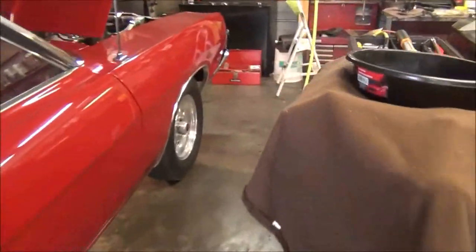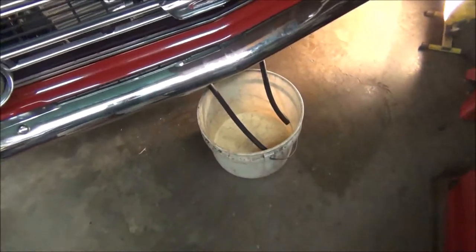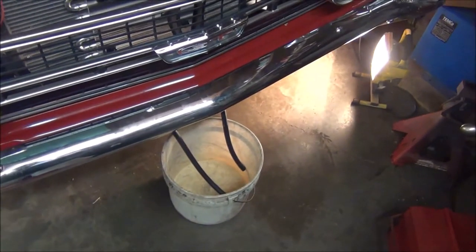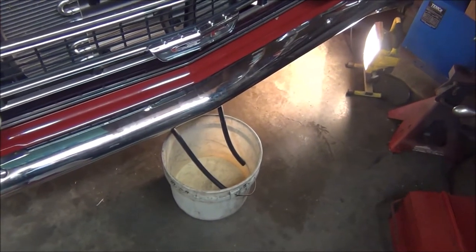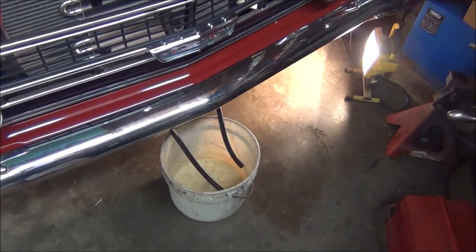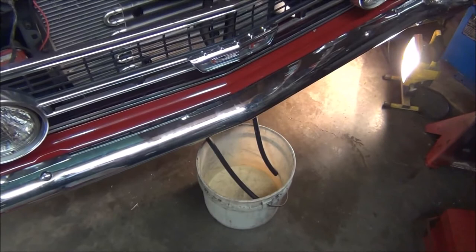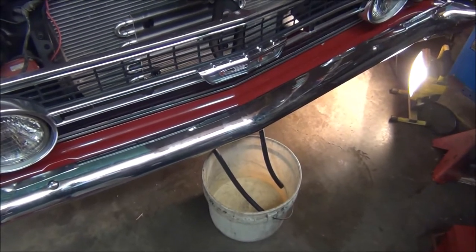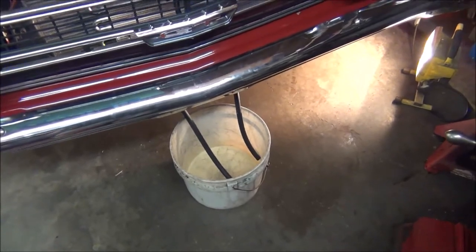Normally, when I really want to get one flushed out clean, I'll pull it out and flush the converter out and everything. But I was looking around online, because if you drain the transmission fluid from just the pan, you're only changing about half of it. Now, if it's a stock one with a huge 14-inch converter, which this one does not have, there's a lot of fluid in that converter. This has got a 10-inch converter in it. It's like a 2200 stall.